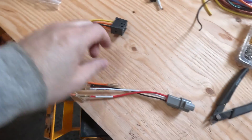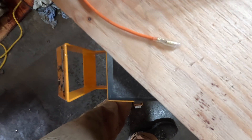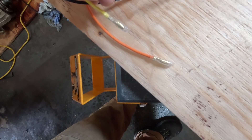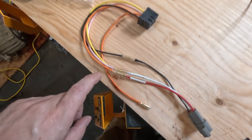Here's how the harness now looks: the adapter plugs into the connector under the dash, comes down with bullet connectors joining the three lines — black is ground, pink is switched, orange is battery — and goes down to my Deutsch connector at the end. Nice solid connector now.